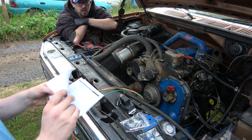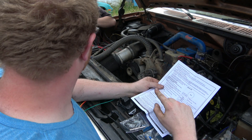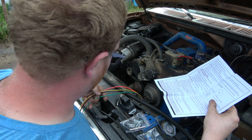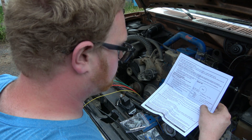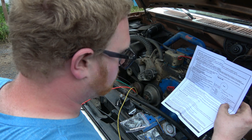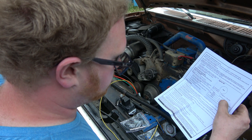Let's look at the instructions again - what's that yellow wire for? Okay, so red wire goes to the battery. Green is the override circuit, black goes to ground, yellow is key-on. And then red with 30 amp fuse goes directly to the fan.